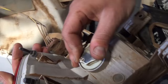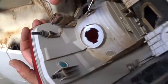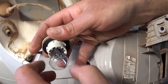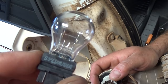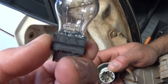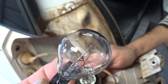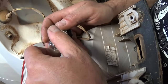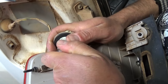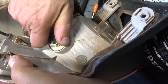If you need to replace the bulbs, turn the bulb counterclockwise about 30 degrees, then grab it and pull it out. This is the original factory Sylvania bulb — the number is 3057. Get the new bulb and push it back in one way until it clicks. Then find the slots — it fits only one way — make sure everything lines up and turn clockwise.